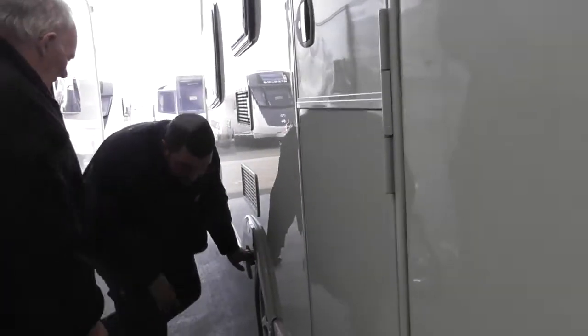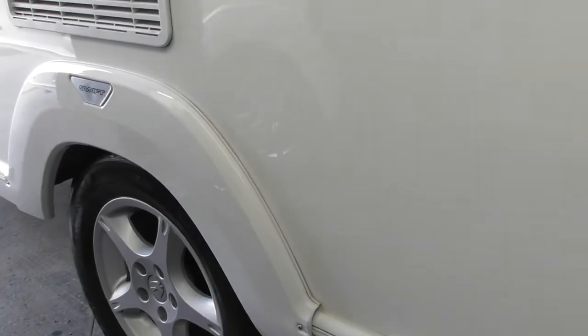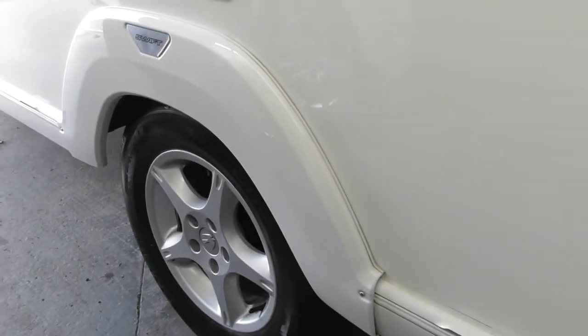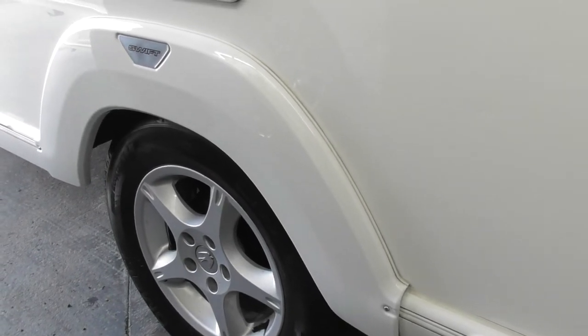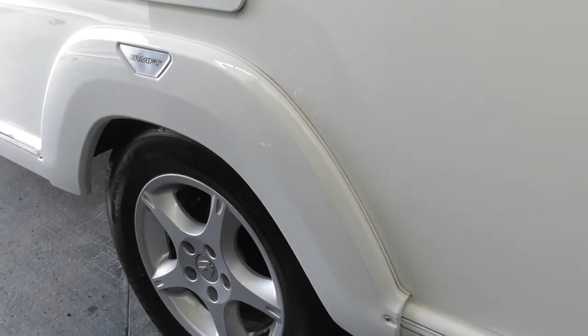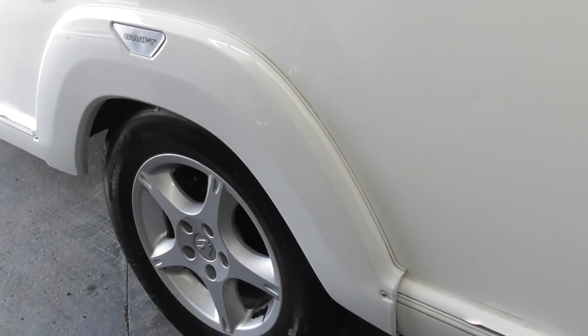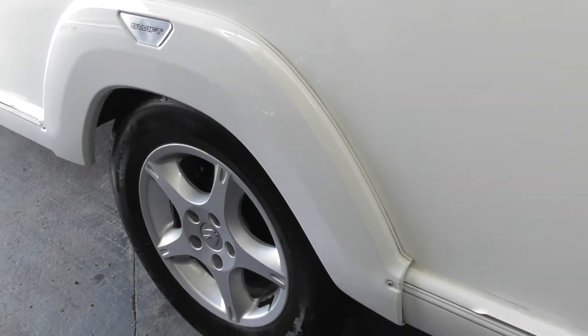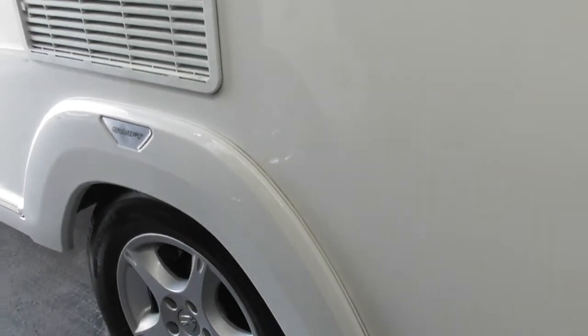Wheels and tyres — they make it really easy and put all the details on the door. It's 65 PSI per tyre and 130 Newton metres for your wheel nuts. It's also got tyre bands on. The wheel nuts have been checked in the PDI — I'll torque them again for you today, but from today on it's down to yourself. Caravans are left unattended for long periods of time — you don't know if someone's loosened a couple off, so before you get on the road just give them a quick check and make sure they're all nice and tight.